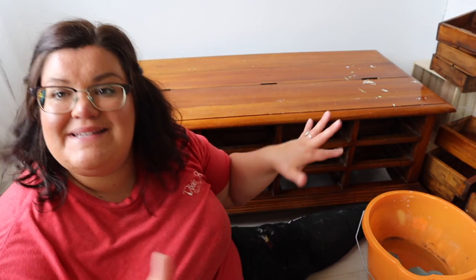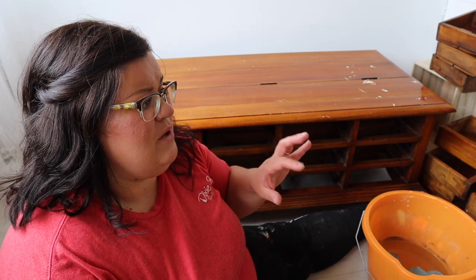So that's the piece cleaned with white lightning. Now what you've got to do is rinse it off. That's to take any cleaning residue away, again to stop that from causing any issues with paint adherence.